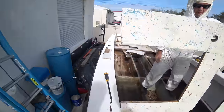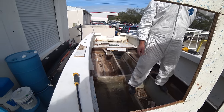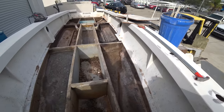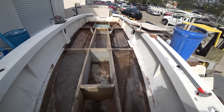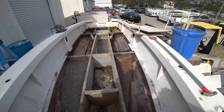Well, we made a little headway on the boat here. We got the floor cut out and found some delaminated stringers that we're gonna have to fix down the side. Both sides seem to be clogged — we're gonna have to get that cleaned out and unclog those. Going forward, we're gonna put in an access point so that if it happens again it can be cleaned out.